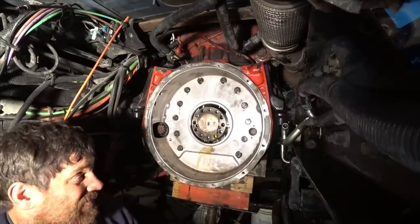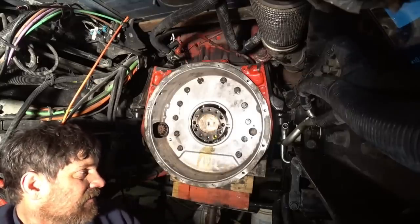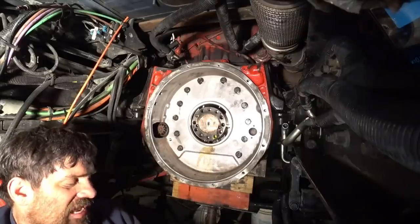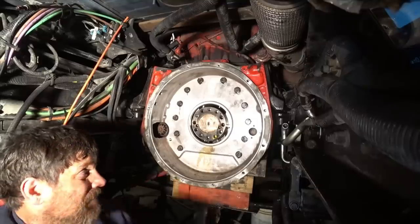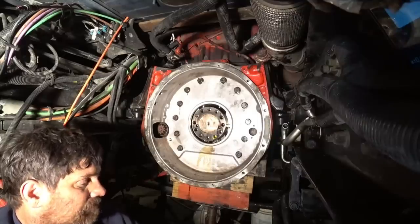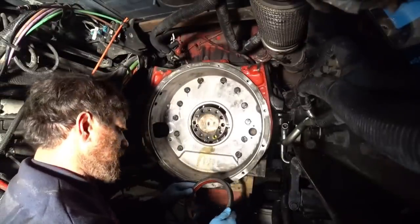If you're wondering what I was doing there, going all over the place, that's off the Cummins website. That's the torque pattern. That's the way they want you to torque it in that order. I have my tablet down there, and I have a picture of it up on there. So we got them all torqued up though. So now we'll throw the seal in. Get that done. All right, it's time to throw this seal in here.